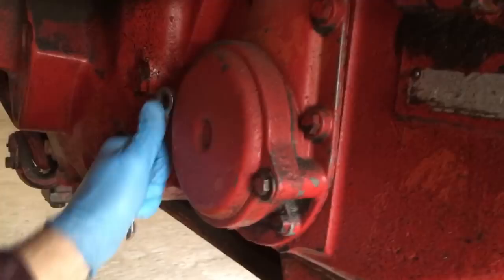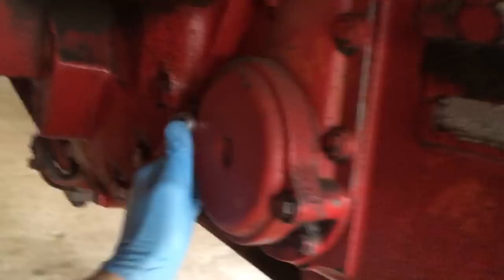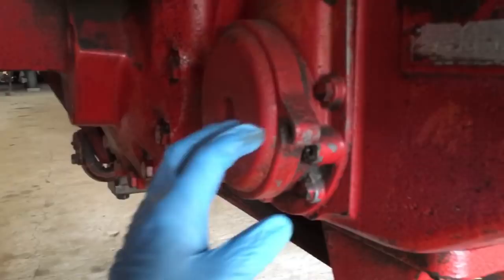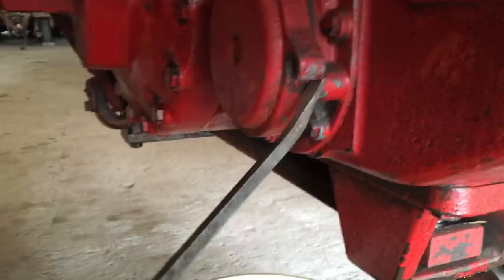You don't need to take these bolts completely off — all you have to do is loosen them and rotate your housing. That one's getting a little rounded off, so let me switch hands. Because of the washers on the heads of these bolts, I had to take them all out or it wasn't going to come off. Usually you just have to loosen them, rotate it, and get a pry bar in behind here.